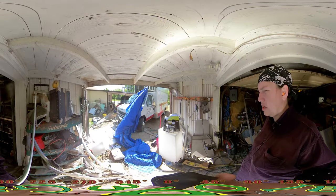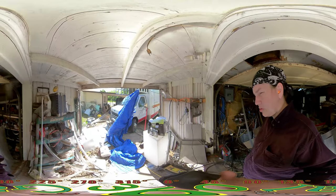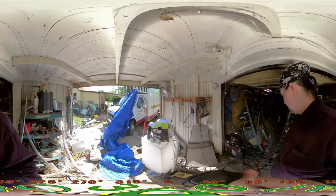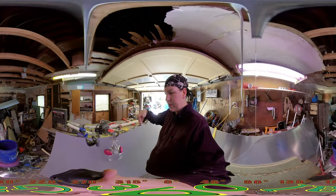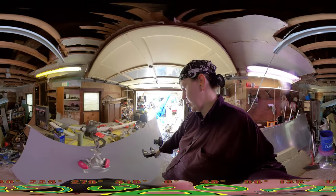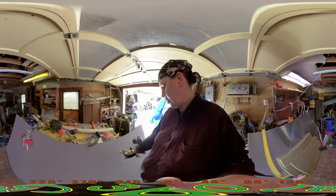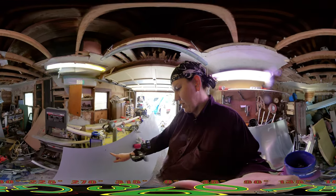So yeah, I'm gonna have to move the ambulance too, and I gotta pull off the angle piece and get it primed and ready and going up. So I'm going to get this drilled. The problem I've been running into is I want it to not have bolts or rivets hanging from the top and hanging down. So I want it to look like it's attached from the bottom. And the only way I can do that with what I'm trying to do is pre-rivet this area here and probably pre-rivet out to a certain point, probably about here. That way I can bend the middle under and get it in there and then weld it all up and then rivet from the outside, the spots that I can rivet.